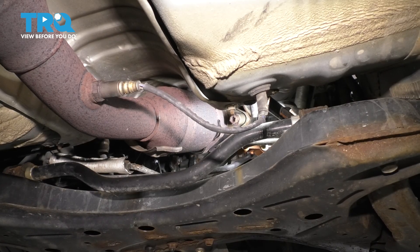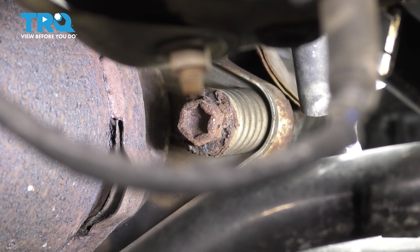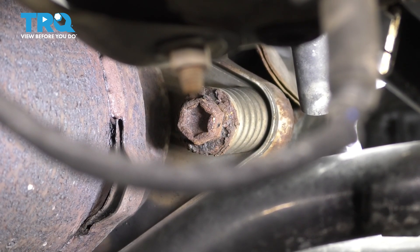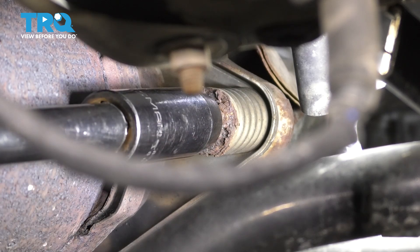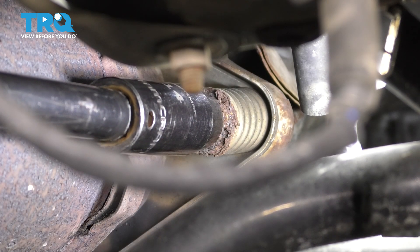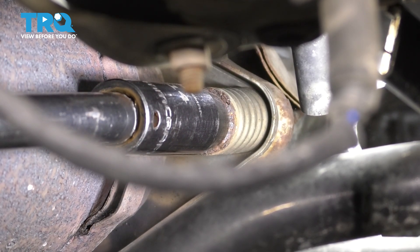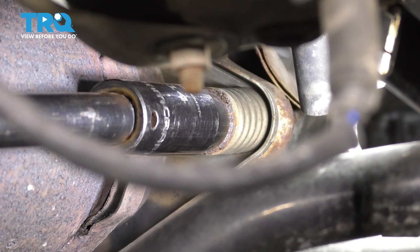From under the car, I want to disconnect the manifold from the exhaust pipe. There are two 14-millimeter bolts — they are pretty rusty, and if they're original, a lot of times they will break, so you probably won't be able to reuse them. Make sure you have new hardware. I'm going to use a hammer to seat the socket because the rust has taken over. I want to make sure I get that socket seated all the way, otherwise I'll strip the head of the bolt. I'll also spray the backside with some rust penetrant.